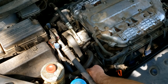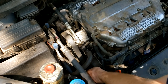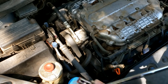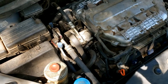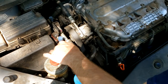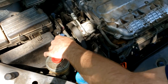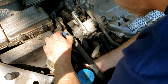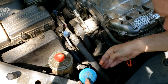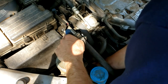The next step is taking off this belt that wraps around the power steering pump and the alternator. I need a 14 millimeter socket and a pry bar on this tensioner pulley so I can release it. The only problem is this air conditioning line is in the way — it's attached with three clips, top and bottom. You can just pop it out of these clips, one down here at the bottom, just lift up on it, and then you can move this out of the way. Then the third one is on the front wall here.